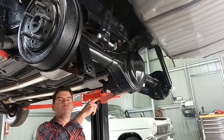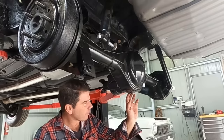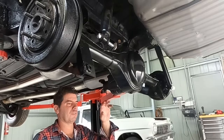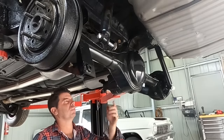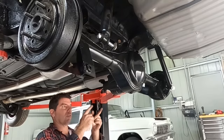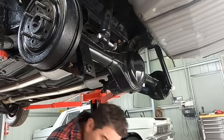Oh, and I won't weld that just yet. There's still ever so slightly oil residue, and I mean, no good can come of that. If it's even remotely got oil on it, it's going to pop and spit and carry on because it's not perfectly clean, and that's just going to make pinholes. So I'll leave that, we'll get all this done, we'll move on, and I'll come back to that last thing, the Savo or something like that. Righto, stop talking.